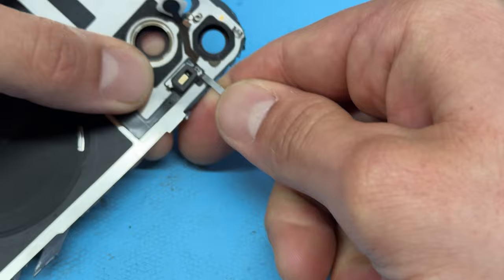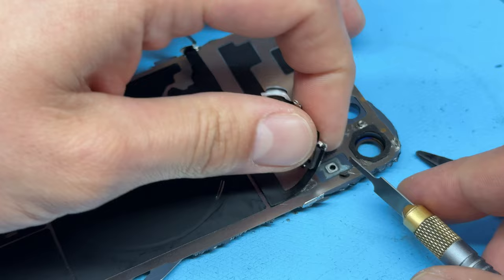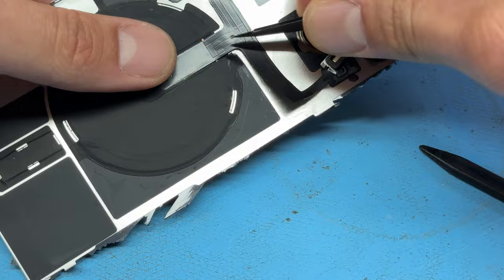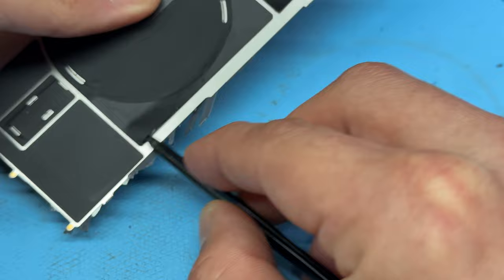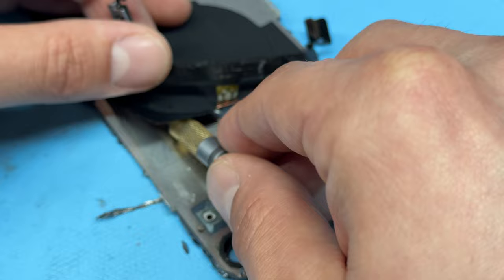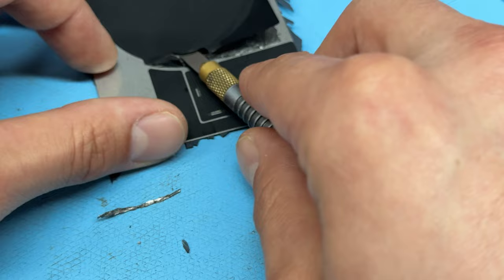There is a metal bracket that holds the microphone mesh on — it's always awkward to remove, so just be careful and use a blade to get between the glass and the metal bracket. You might need some more heat to help it along, so I'm using the heat gun to soften the adhesive and the blade to get underneath it. Now we've got all of that out, the last bit is this wireless charging coil with its black adhesive on the edges. We need to get in between the glass and the copper coil, then work our way around prying it upwards and separating it from the glass. Remember this glass is already damaged so it doesn't matter if you break it, but we don't want to damage the wireless coil — peel that last bit off carefully.